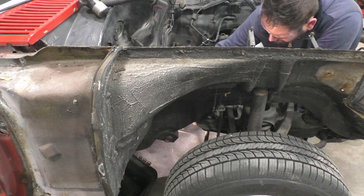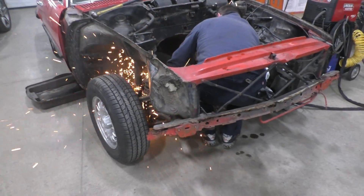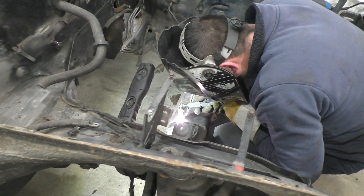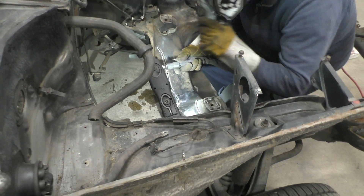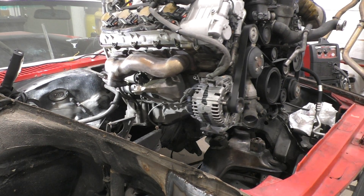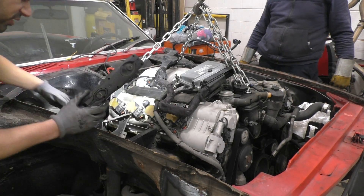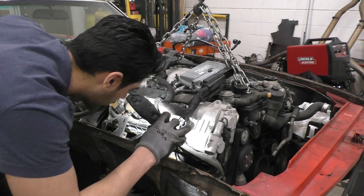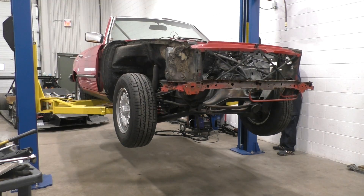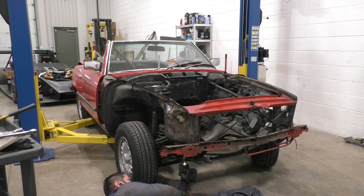Some parts of the steering system were part of the chassis so we had to cut them away. After that it was time to start a whole lot more cutting on the subframe — cutting away everything needed to make this engine fit at its proper height in the chassis. After quite a lot of cutting we realized this task was not going to be easy, so Sebastian removed the entire front subframe from the car. We decided to put the engine on the subframe itself first, make it line up on the subframe properly, and then move on to cutting the chassis.